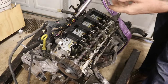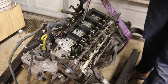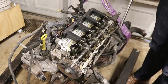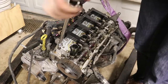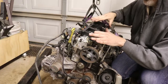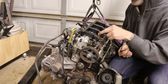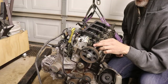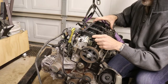Starting with bolt number one. These are T45 Torx socket heads — if you don't have a good Torx set, get a full set; I'll put a link in the description. I'll loosen all the bolts first, then remove them all. With all bolts removed, I should be able to lift off this valve actuator assembly from the head. Important: don't invert it — there's oil in it right now, and if you turn it upside down you'll have to crank and crank the engine to refill it with oil.